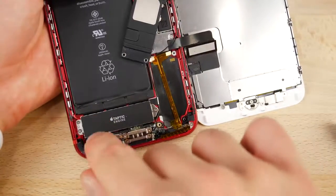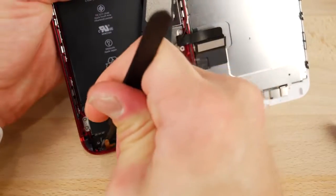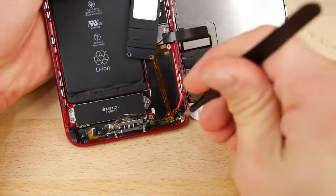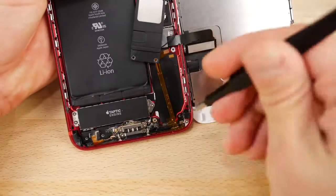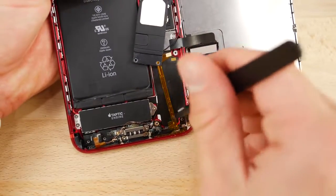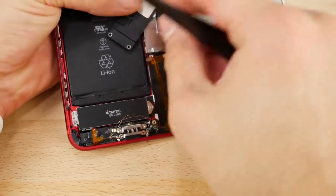All right, so I just did the left side. Basically, you pop the LEDs in, then nestle the plastic back on top of it, seal the waterproofing seal, and then you wanna go ahead and do the same to the other side. So this needs to nestle into the speaker grill. It's kinda hard to do this when I'm trying to demonstrate it. But you wanna make sure that the LEDs line up with the speaker grills, as there is one LED per speaker grill for maximum effect here.